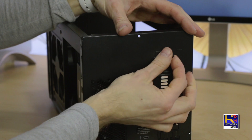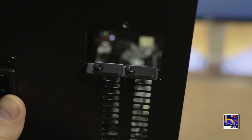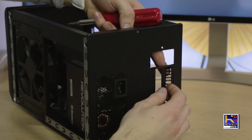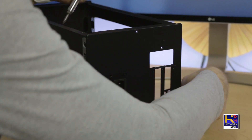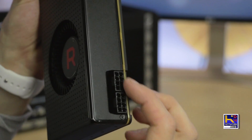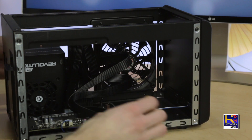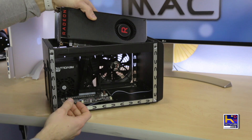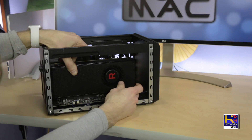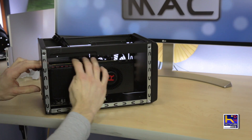Let's go ahead and remove the top bracket so we can get our card installed. We're going to grab a screwdriver and remove these two spacers. Now this power supply has two 8-pin 6-plus-2 connectors. We will be using both of these in the Vega as it calls for some massive power. So let's go ahead and insert the card — there's a clip, it will slide right in and clip. Just like that.